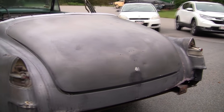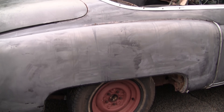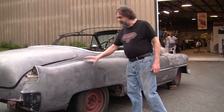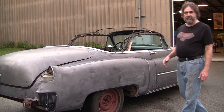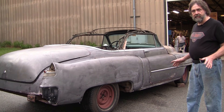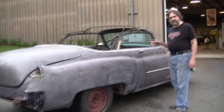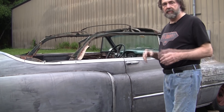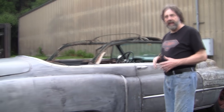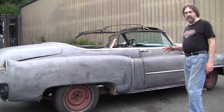Just like we were doing the Scout Series, we're doing the Cadillac — a little bit of Cadillac, a little bit of Scout, showing every step of the restoration process. This is the first step: assessing what you have, removing all the years — the 54 years of grime, grit, and rust — getting down to the surface and finding out exactly what is the condition of the metal. By doing it incrementally, we're going to take this fender off first, work it out on the bench, get it all cleaned up, put it right back on, and check all our body lines. We'll be able to see if the shims need adjusting. As for whether we take the body off — I'm going to wait to see how the frame and underneath clean up before making that decision. You'll be amazed at how clean it will get.